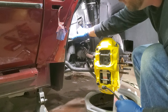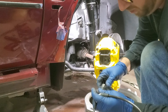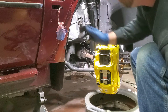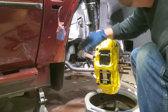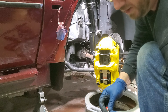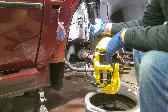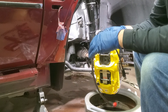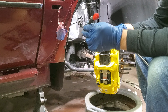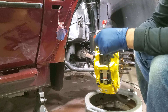We've got the flex line to put in. I've already got the original flex line off — this literally bolts and screws right in place of the original spot. You have a set bolt, and the nut goes right in place. It does come with washers, though you don't actually need them because it fits just perfectly. Then it just attaches right here — there's a little spot behind this right in the center of the caliper that this side goes to. It does have a brand new banjo bolt and two crush washers. It supplies everything you need, and it even uses the factory brake line bracket right here. It's really nice construction — dark colored, braided stainless steel line, coated so it's not going to chafe or anything like that. Good stainless steel ends — really stout quality hardware to go with these big brakes.